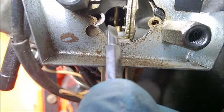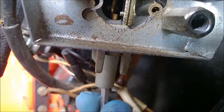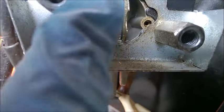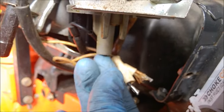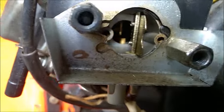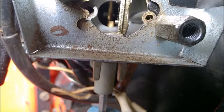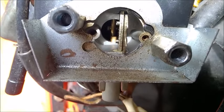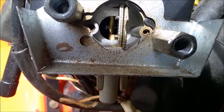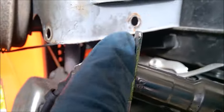I can't really help beyond this — just try to screw it in and don't force it, because copper is a very soft metal and you will deform it. At some point, hopefully you will see the tip coming out. If you don't see the tip coming out, it's not good — the screw won't be tightened all the way and the tube may drop back. The emulsion tube will not sit properly and may not scrape the gasoline properly. Just tighten it with your fingers. Notice the choke is full open here — that's the tip of the emulsion tube.